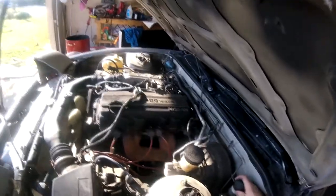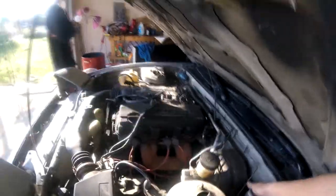That's the master cylinder down there. And we're gonna have to bleed that out because you don't want fluid that bad. The clutch is probably not even engaging all the way because of that fluid, and there's probably no air. That's why when you do clutch jobs, you get all the old fluid out first, because if you did that with brakes and it was that black, you wouldn't be able to stop. So we're gonna get to this.